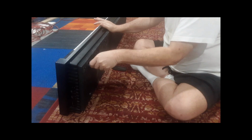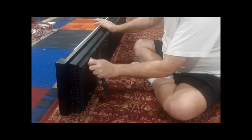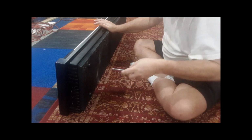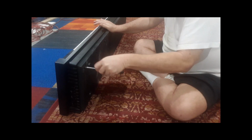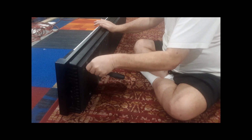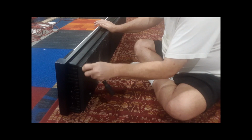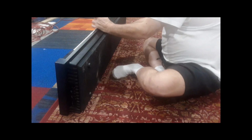because on a KX88, they lock down the top panel, main panel, by using these screws underneath. So it's a little extra step from the DX7. You don't have to get under the DX7 to open it at all. But I guess they did this for extra safety because it is a fairly long panel. So they wanted to secure it down at this end. So you have to remove these 2 screws, the 2 most left screws, and the 1 rightmost screw.